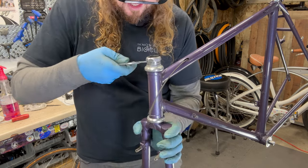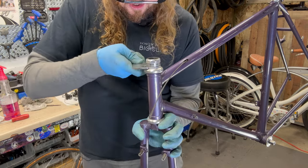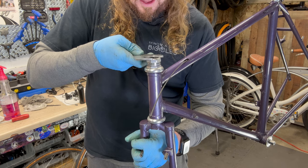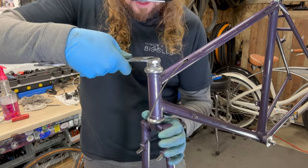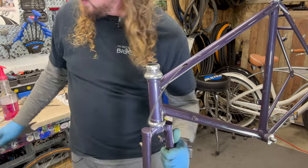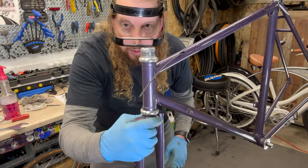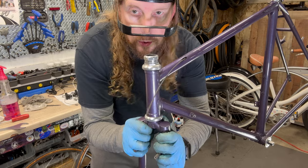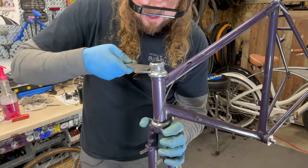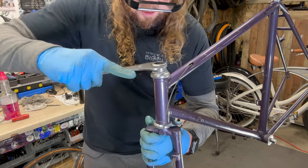And the idea is see how it binds up when I tighten it down. Then you can back off this so it releases the pressure. And that's what you want to do for the final result. Make sure you tighten this down, then you double check and back that off. So, almost like a hub. Woo! So, smooth, but not loose. So, there's a little knock in there. So, that means I need to tighten that down. It'll be a lot easier when I have the wheel in place.